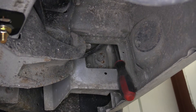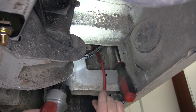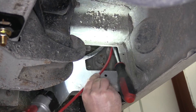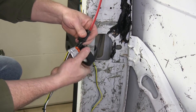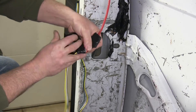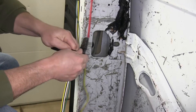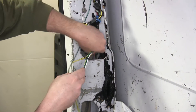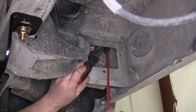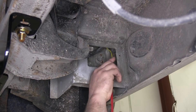We're going to leave the screwdriver holding the piece of plastic up a little bit as we take an old section of airline tubing and fish it from the bottom up into the rear part of the vehicle. We'll go ahead and take a little bit of electrical tape and connect the end of the 4-flat to our airline tubing so we can pull it down. Then we'll go down underneath the vehicle and use our pull wire to pull the 4-flat wiring down underneath the vehicle.